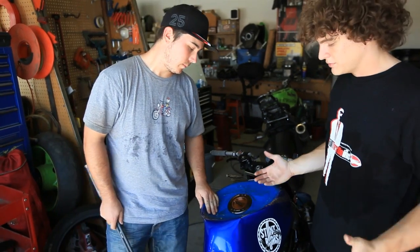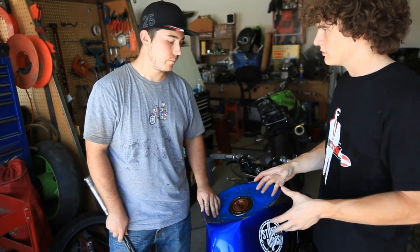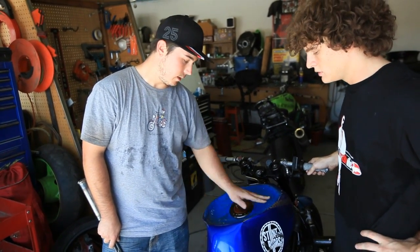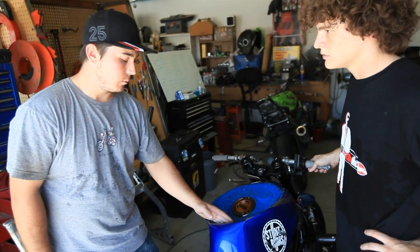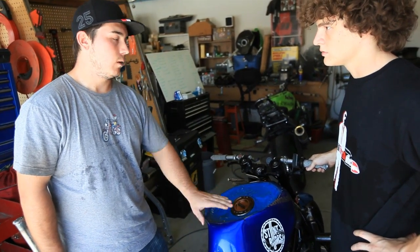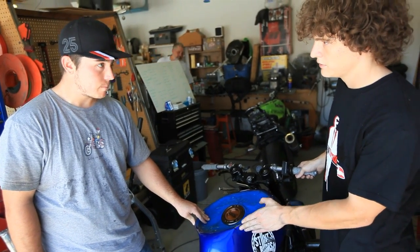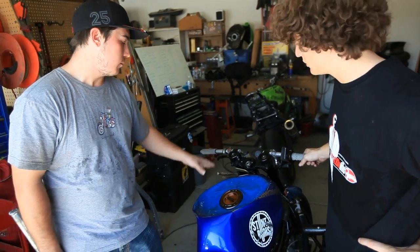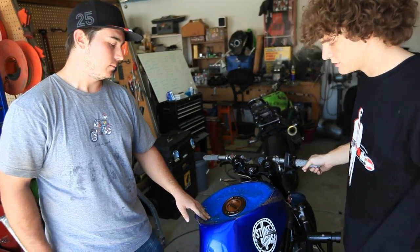This is the current tank dent. I mean, it's not a bad dent, but we're gonna have to beat it back a little bit now, right? So when we put in the metal, we don't change the actual position that I'm sitting in. Right, it's pretty wide. It's actually a really nice dent. But we're gonna bring this back and then replace it with metal that kind of comes up where this was, and maybe a little higher, and maybe make it a little more rounded and just all around bigger. Gotcha. So we just put some marks on the side of the tank here. That way we know where we need to put the new metal. Yeah, marked it just where you were sitting so that when we get done, it should feel very similar to what it was, just held in better. Nice. Now let's get to it.